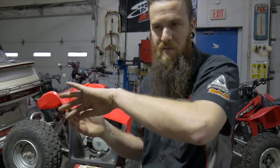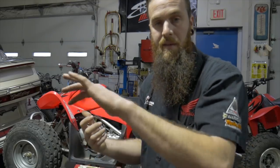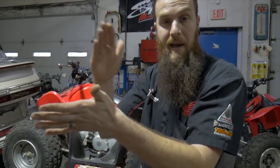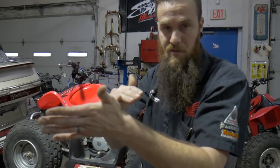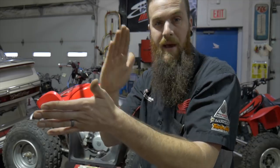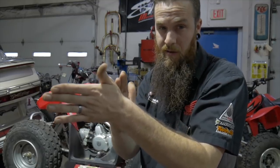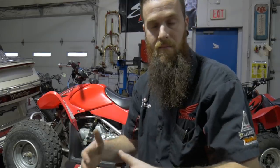What I mean by that is, as soon as it drops off of that highest point of idle, that best running condition, the idle drop tells us, okay, let's go back to where that was. Once we locate the drop in RPM, or in the way it runs, we can backpedal and say, okay, that's too far in or too far out. Let's bring it back to where it was at that highest idle. So we're idle dropping the mixture to bring it back in to its higher idle, and then after that, setting the overall RPM with the idle adjustment screw.